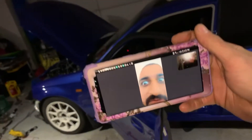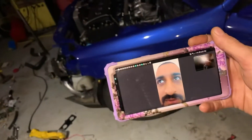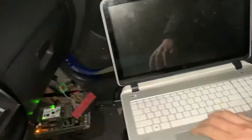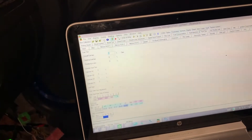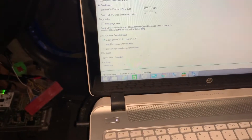Munim is here. He's been a part of me building this car and he's supposed to be here for the first start. Yesterday at 12:30 the car wouldn't start, probably because in my computer the coil-on-plug setting was not set — in the miscellaneous tab, right here. There's this CPR output. Travis told me I probably should have done this. So anyways, now it's ready, I think.